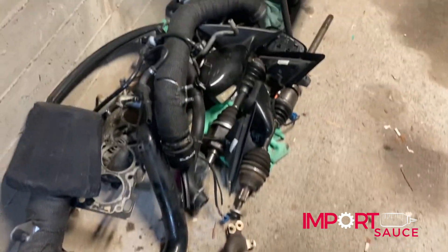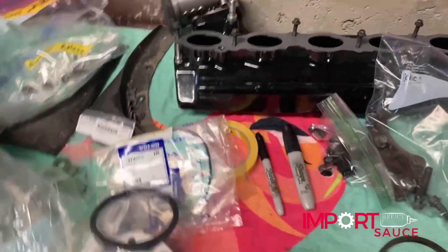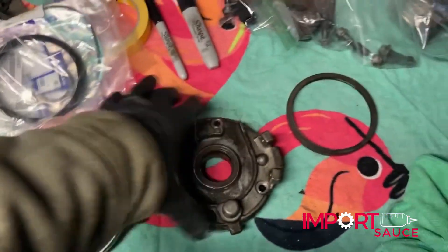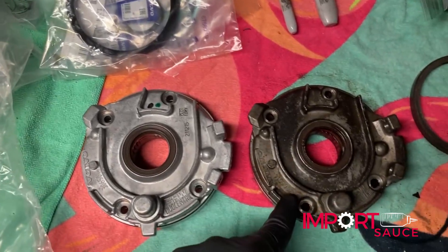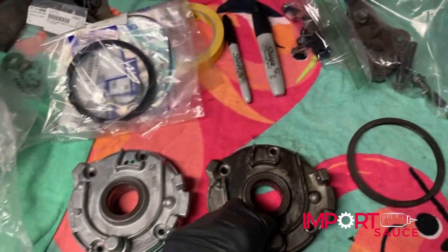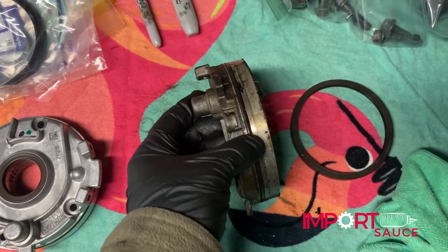The turbo just came off today, that was the last piece. We've already started cleaning this up, but before we got too far I just wanted to show you what we do. Part by part, we look at the old part — I'll show you an example here. Oil pump, right? We unbox and visually compare everything, you can look at part numbers here, everything matches, everything looks good. And then we want to pay attention to all the notes that we made in terms of seals for each of these parts. So we have the rear main seal, which went in there, and we have a gasket to block. It looks like there's a gasket there as well.